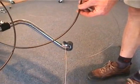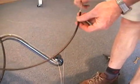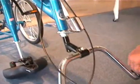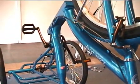Our next step will be installing the 3-speed shifter. Take the cable from the shifting handle and thread it through the cable housing. There is also some front brake cable housing. Make sure you choose the cable housing that goes to the back of the bike.